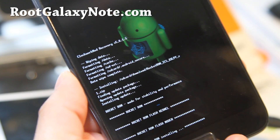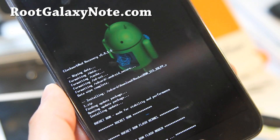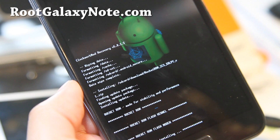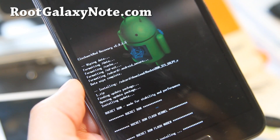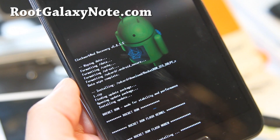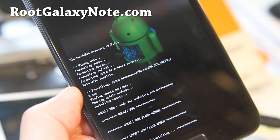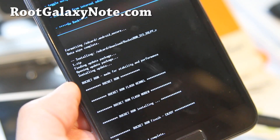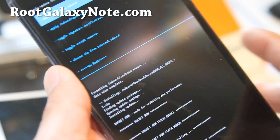If you're already on ICS, you can just go ahead and install directly. But if you have any problems, you can always follow this method to install any ICS ROM. If you end up in a boot loop, you should still be able to get into ClockworkMod Recovery and install it. Also, some ICS leak ROMs don't come with a recovery — in that case you can Odin the kernel using a tar file, or extract the zImage from the same zip file and flash that in Odin.